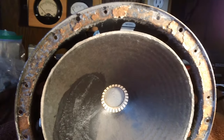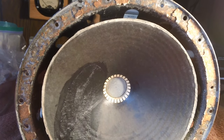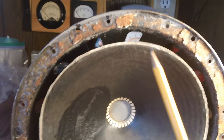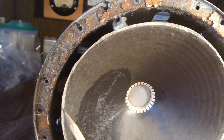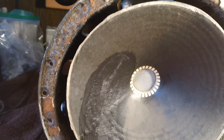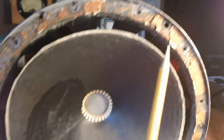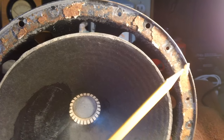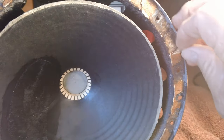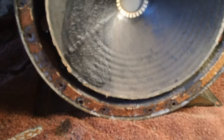Before we do that — it's not going to be an awfully long video I hope — right now I'm in the process of removing this white edge along here. This is the old glue that held the surround on. The surround was a cloth and it just flakes right off when you touch it. You just get up under there and it comes right off — kind of nothing to it really. Then I'll have to clean up this lip all the way around.